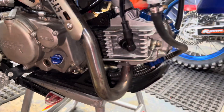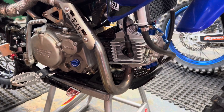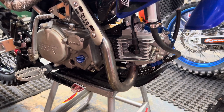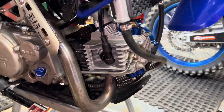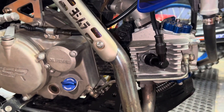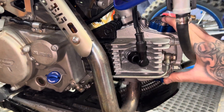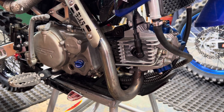And can you do it if you're not going to use the big bore kit like me? The answer to all those questions is yes, definitely worth it. They make way more power than the stock head because they've got a bigger intake valve and bigger exhaust valve. It also has the roller rocker design which is nice. You can't see those under here, but on the new head that I'm assembling in just a second you'll be able to see all that.